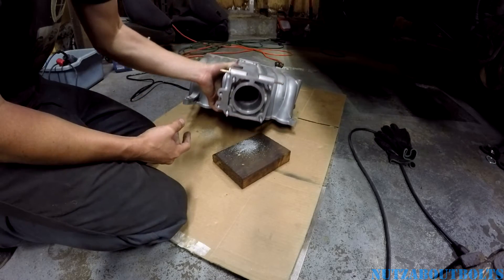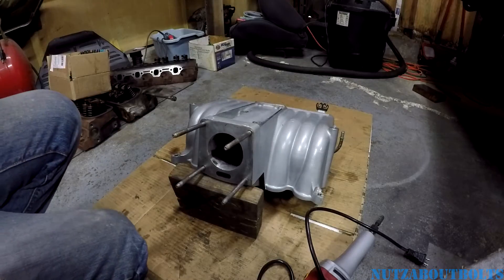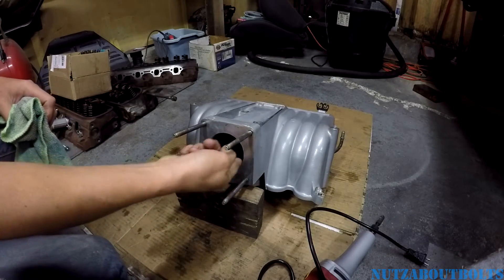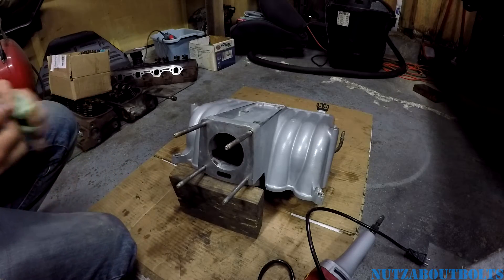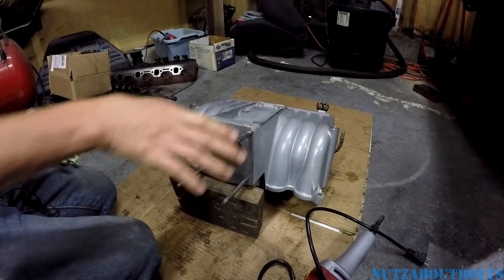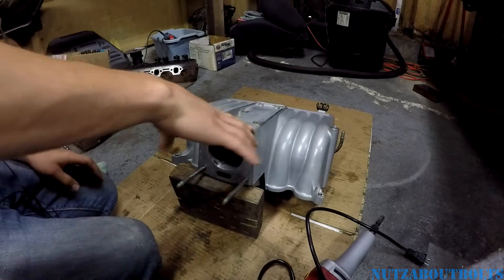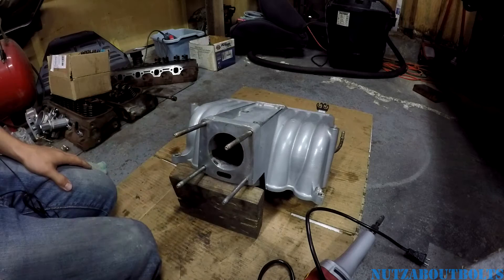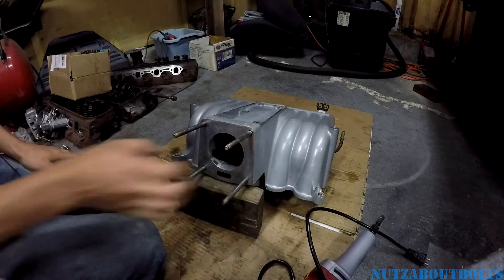We'll have a nicely matched up manifold and EGR spacer, and we're one step closer to putting the GT40 setup onto the Mustang. I've got it all ground out — I have the opening shaped to match the spacer and the throttle body. You might be wondering why it didn't line up. Well, the Explorer had the 90-degree elbow on it, and everything with that setup lined up. But once you take out that elbow and put a straight spacer in there, it wasn't aligned anymore. So I just had to do this to get a nice smooth flow.